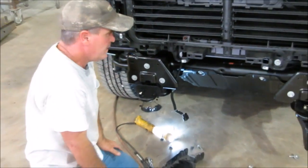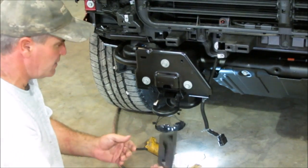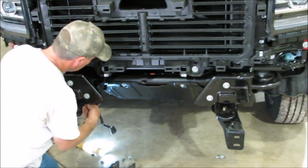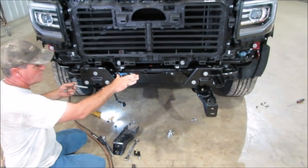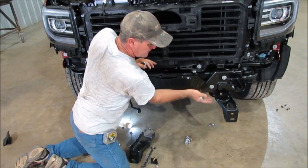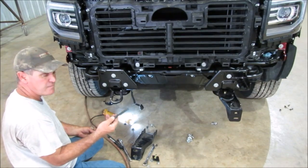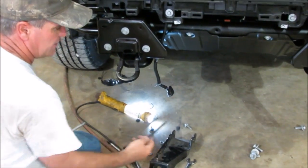On this other side, when you take the bumper off, there's just this little pad right here that you need to go ahead and take off — you don't need to put it back on. In order to get this long bolt out, because Chevy puts it where they all go on from one side, you've actually got to loosen all three of these. Or you can take them out, take that plate off, get that bolt out, and then put the plate back on. You're going to replace this bolt with one provided — it's a half by five inch instead of this one.